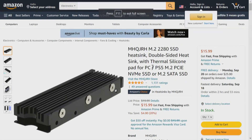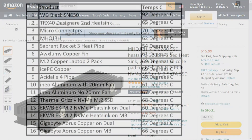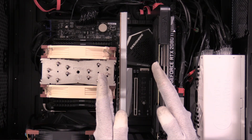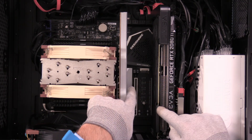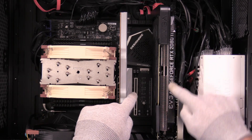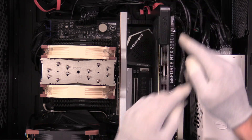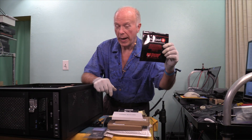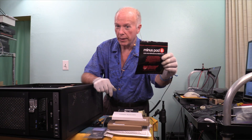One possibility for a PS5 heat sink for an existing drive is the MHQ JRH. Looking at the updated chart, I've numbered these heat sinks according to heat based on the WD Black SN850 at the top. The two M.2 NVMe drives connected to the CPU are the fastest. That's where we tested and got those numbers. The MHQ JRH with one stock thermal pad — probably 4 W/mK — versus the Thermal Grizzly at 8 W/mK: our results will be better if you use these upgraded pads.